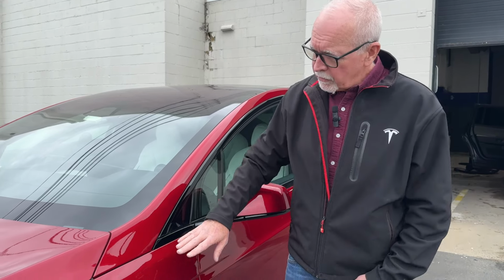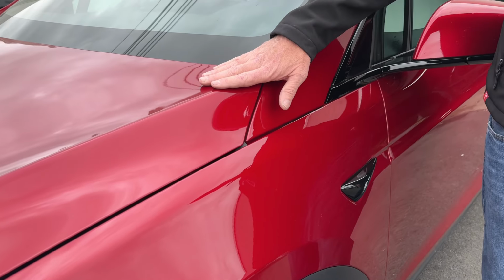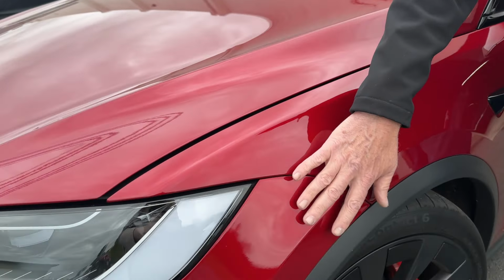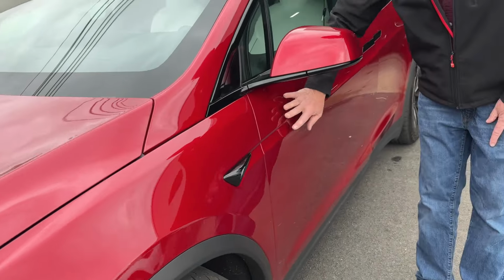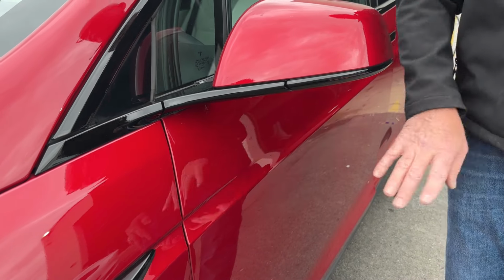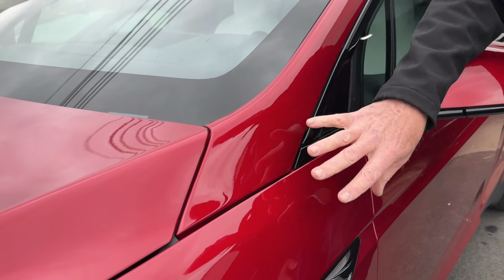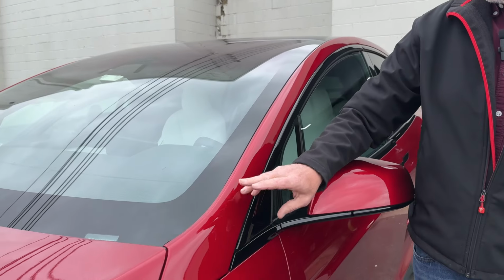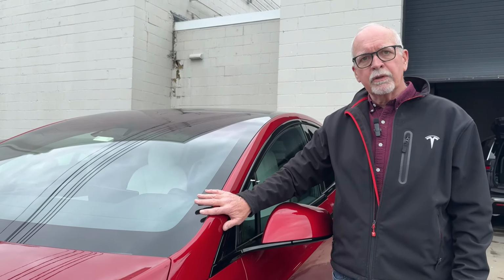So on this vehicle, this panel moves, the fender. This panel moves, the hood, it's attached at the hinges. This panel here is removable and moves. It's got bolts, the front bumper cover. This panel here moves. It's the door. It has hinges, and you can make some adjustments. But this panel right here, the roof rail, or the A-pillar, does not move. This panel is welded onto the vehicle. So we always want to start by thinking about what panels on the vehicle don't move.